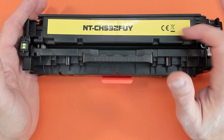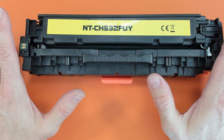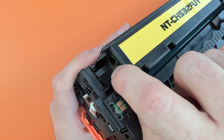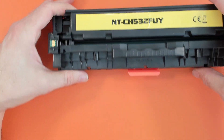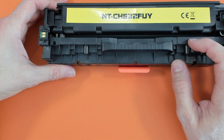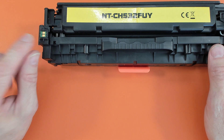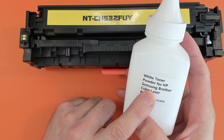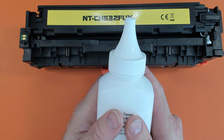How would I make this work with white toner? I've completely stripped this cartridge down and emptied it out. I've also given it a good wash so there is no yellow toner left inside, and luckily as it was an aftermarket toner it already has a fill hole — that's where you put your fill hole if you don't have one. It's important to make sure the toner thinks it's a black toner, so I've swapped out the chip for a black toner chip. We'll be replacing the black toner in the printer with this one containing the white toner powder, and we'll be printing in black but using the white toner powder.